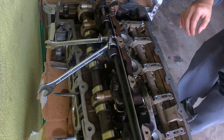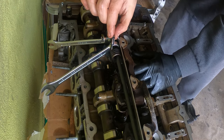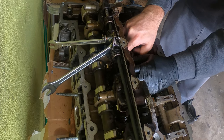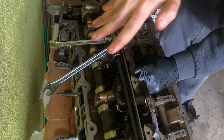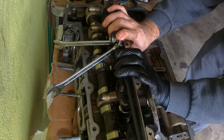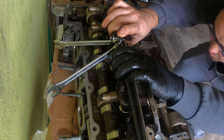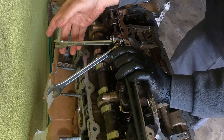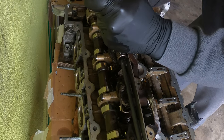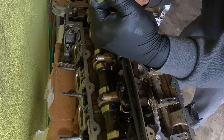All right, ladies and gentlemen, let's try this again. Take four. We're going to, again, adjust the camshaft so that there's the least amount of slack on the spring possible. That means these little intermediate rollers will be the furthest facing back. We can then slide our spring in and look to see if we can get the end of the spring to sit in the tabs that are there for it. We're going to then put in our rod and all that stuff. Well, you should do that actually first, putting your rod through the spring. And we're going to put the bolt in here under a little bit of tension at the top, just like that.